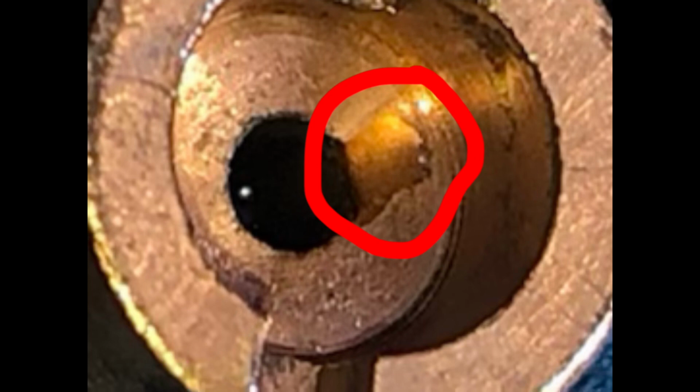Alright, so this is after the fact, and I am editing the video. The piece of trash that was in the carburetor was the problem for that. Right now, the car is running good. I still have a little bit of a problem at high RPM. It starts kind of breaking up and cutting out. I don't know if it's a fuel problem or back to the points. I gotta figure that out. It's had this problem for a very long time. Before, when I had the old cam and everything, it's always had this problem. So I gotta look into that.